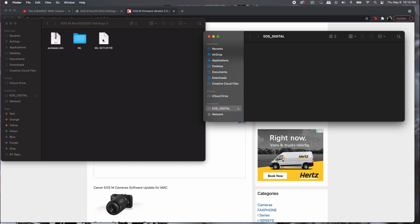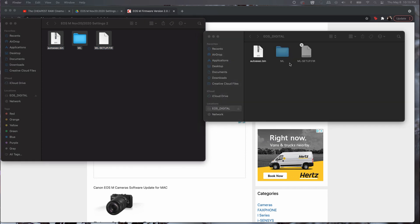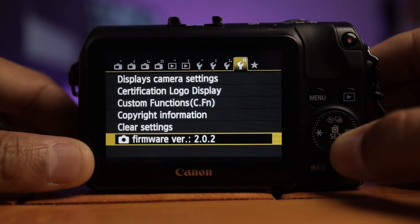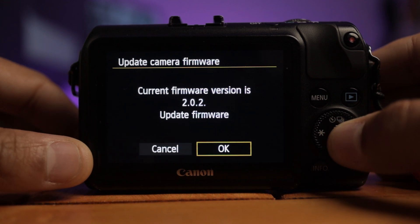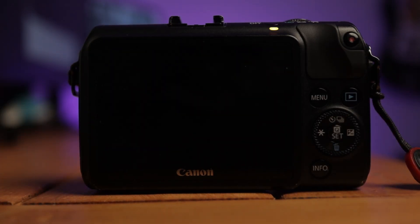Now we're going to jump over to my computer so you can see exactly what I'm doing. I've got my two windows — the customized build that Zeke set up and my SD card that's ready to go. I'm going to copy these three things and paste them onto the SD card. That's all you need to do. I'm going to eject the SD card and install it into the camera. Once the SD card is in the camera, go to update firmware — that's where you load Magic Lantern from the SD card. Note that your camera must be set to photo mode on the dial, not movie mode, because in movie mode you can't access the firmware update option. Switch to photo mode, go to firmware settings, update it, and just like magic you're running Magic Lantern.